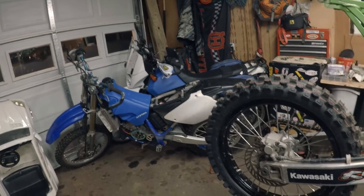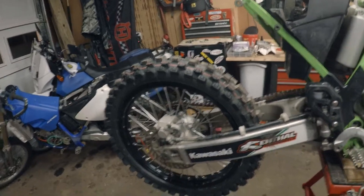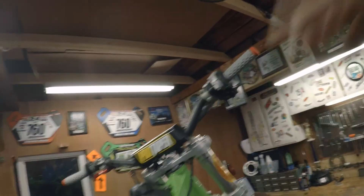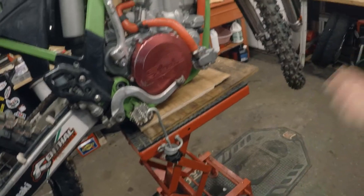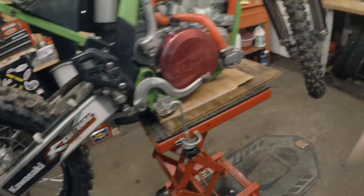I'm going to get this thing up on the stands. I do have a table but it's outside and project woods ripper and the Ducati are in the way, so I'll do it the old way - a stand underneath each end, then a ratchet strap through the rafters to the handlebars to keep it up. I lower the scissor lift down and put a piece of plywood on top to make a nice table, so I can drain the oil and work on my stool. It's pretty mint for a tight garage.